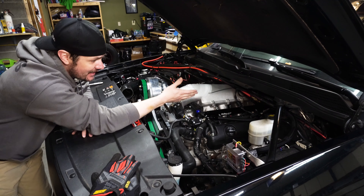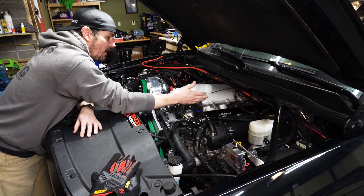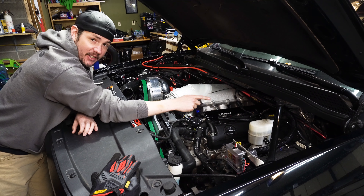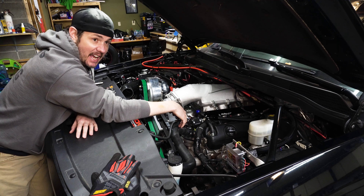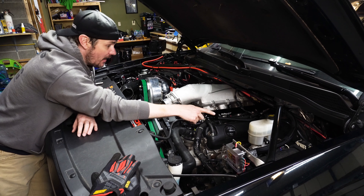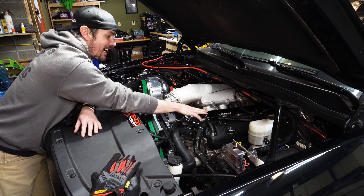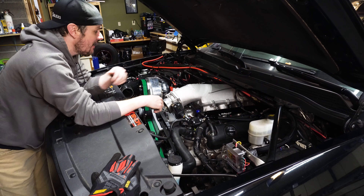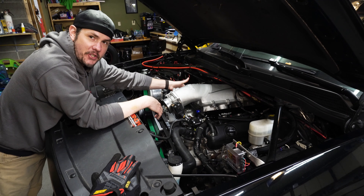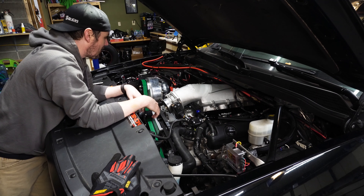The line is perfectly fine for getting pressure up to the high pressure fuel pump, but by adding the additional flow requirements up here, we may have an issue. It won't be a big issue because somewhere underneath the truck we have an AN10 or AN8 fuel line coming from the fuel cell up to the factory line. We can tee it off there and bring another leg up here and tie into the auxiliary stuff. But because we might do that, I want to install an additional fuel pressure sensor so we can monitor pressure through the micro squirt and keep an eye on how everything is reacting.